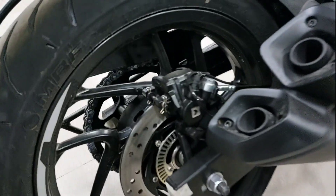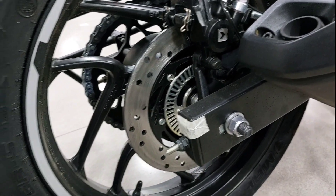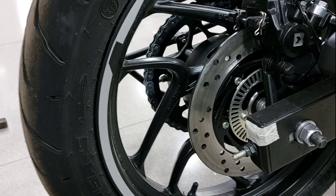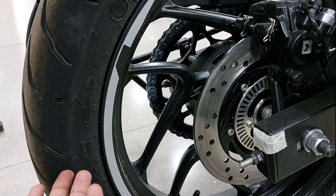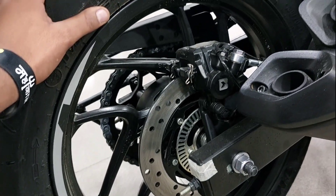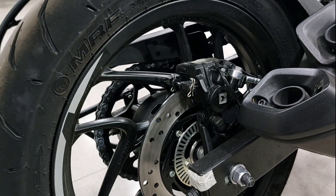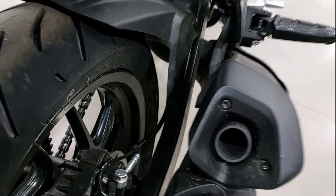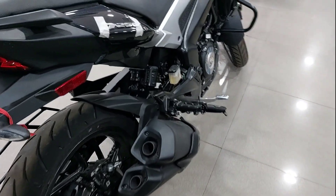Here you will see the disc with the ABS link — dual channel ABS with a Brembo brake. For the rear tire, there is a little disappointment: a bike of this class should have at least a 140-section tire, but the Dominar 250 comes with a 130-section tire, same as the NS. However, there is enough space to fit a 140 or even a 150-section tire. If you are buying a new bike and going to the showroom, you can change the tire the same day. I recommend the Apollo Amazer H1 as the best tire for this bike.